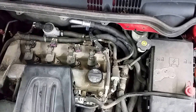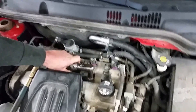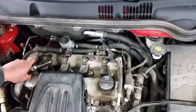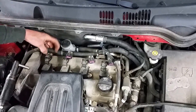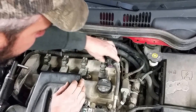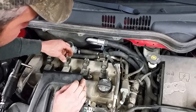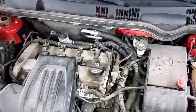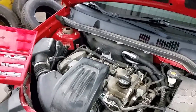Now that you've gotten all those tight, go back through and plug your coils back in — you should hear it click when you snap the connectors in. After those are reinstalled, push in the gray locks that you removed previously and you'll hear those click also. The next step is to hop in the car, start it up, and make sure the engine is smooth — there shouldn't be any skipping or shaking.